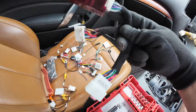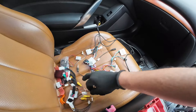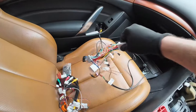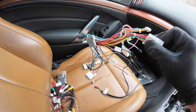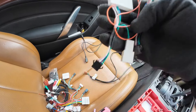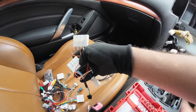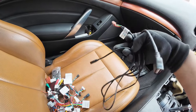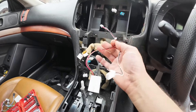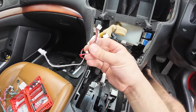This is an audio decoder for your factory Bose. This connector is for aftermarket and factory reverse cameras and works alongside the adapter that connects your factory reverse camera. This is your hazard light and airbag connector. This is the main harness — only use the connectors involved with your head unit. Extra connectors are for specific head unit models; do not use these unless stated in the booklet. This includes specific models like Australian and Japanese models. USB cords connect to the Tesla screen, there's optional charging, and the GPS connects to the Tesla screen as well.